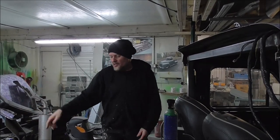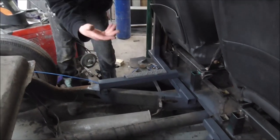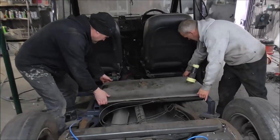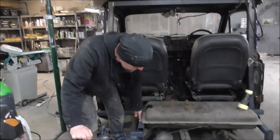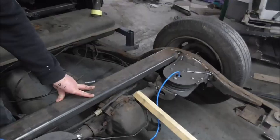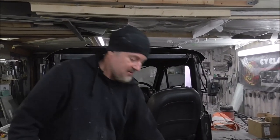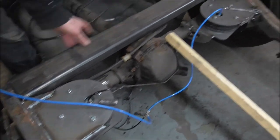This tilt and slide ramp means we've moved the fuel tank up here. We've built a frame in 2x2 box section with rubber mounts to cut down vibration, all primed up and ready to fit the tank into place. The fuel tank is in and packed on rubber mounts so the prop shaft doesn't catch it. We've also welded in this almighty piece of 2x4 box — that's what we're going to pivot the tilt and slide ramp on. In happy coincidence, we can weld the bag mounts to that too, so it's incredibly strong. The back of this car is about a thousand times stronger than it was this morning. We've also mounted the fuel tank off-centre so we can tuck the compressor and air tanks neatly away on the other side.